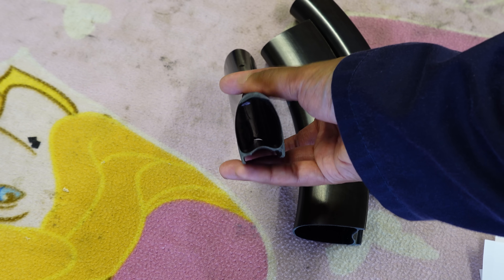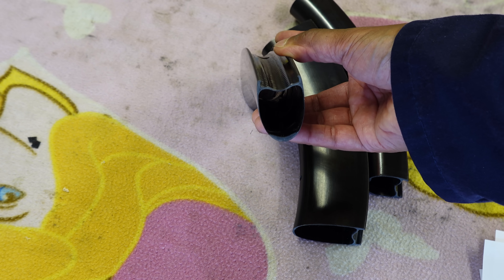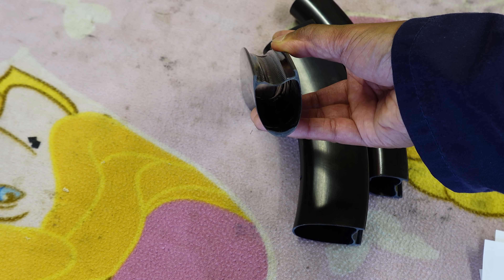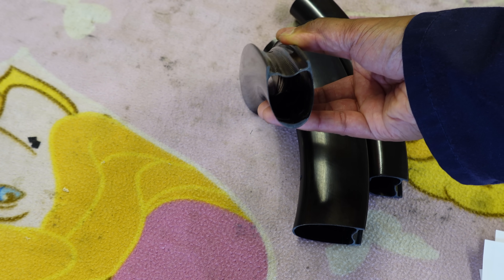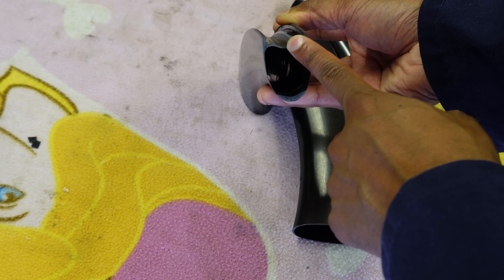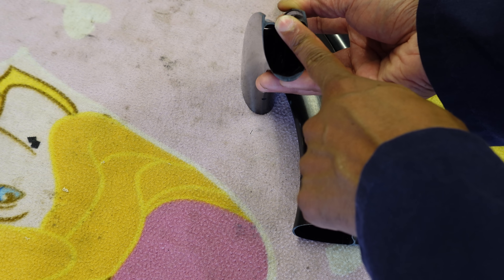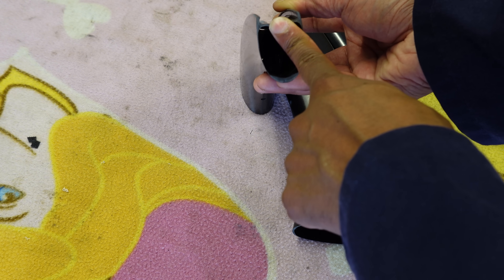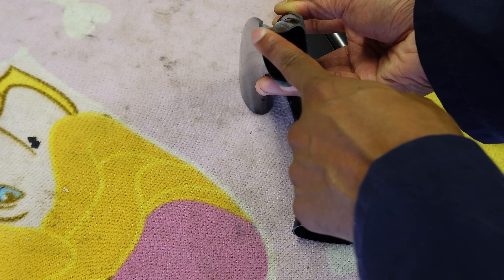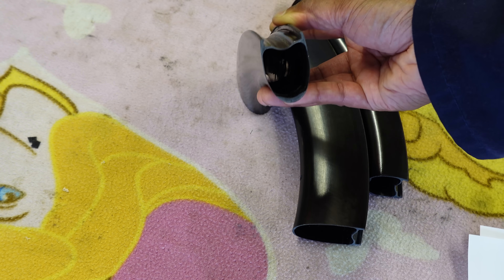One thing not really highlighted in their marketing material is the rim strength. These are rated for 120 PSI before the safety factor is applied. Assuming a safety factor of 1.5, that would be 180 PSI, with a weight limit on that. As the rim gets wider the stresses on the hook corners get higher, but this is a hooked rim so the chances of it coming off when you hit a curb are quite slim. 120 PSI is really good and indicates the rim is quite strong.